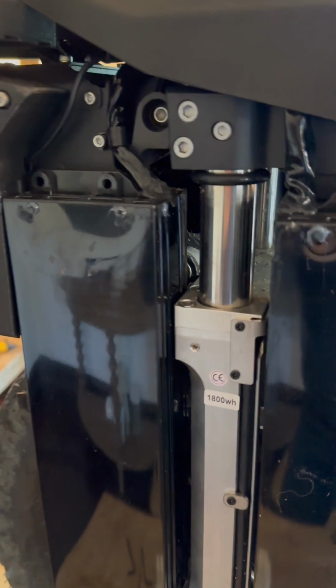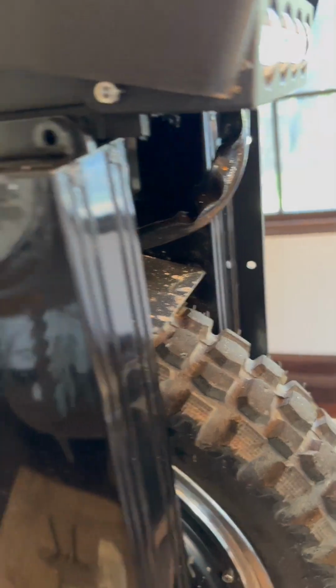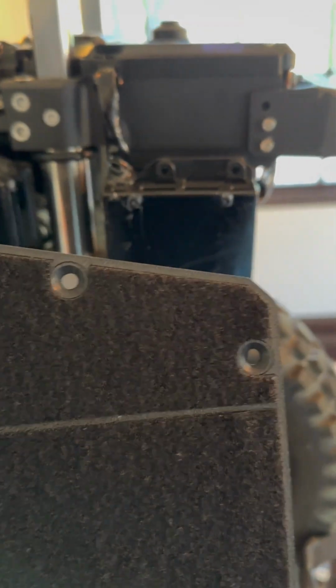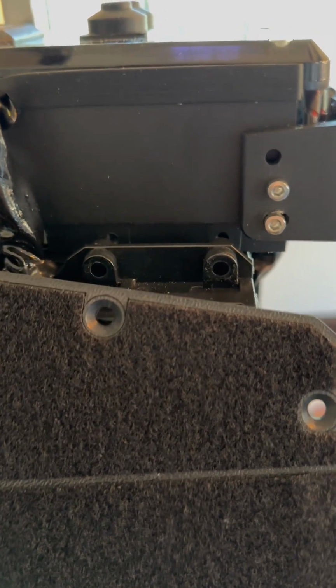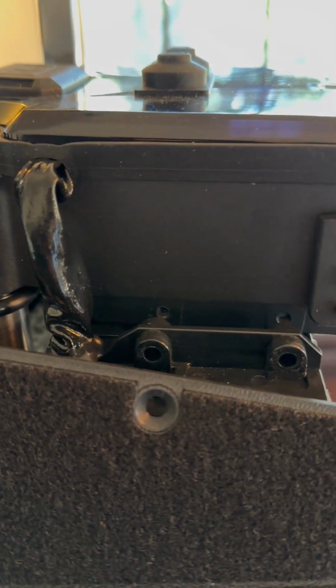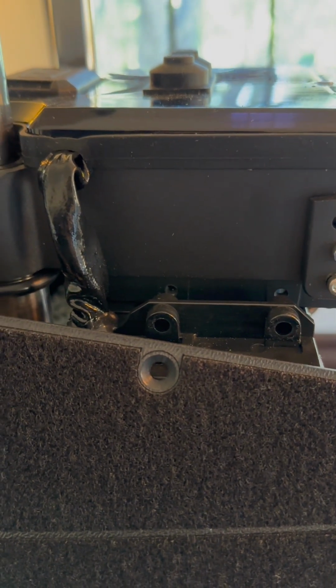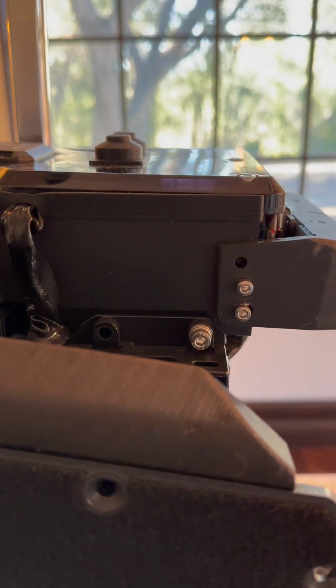Okay. I've got some silicone on these screws all around the inside, sides, outside. I'm going to put the other fairing on. One thing to be careful of is, notice that the top only has 3 screws up here versus 4 down here. So the one right of this screw hole, the one on the right there, needs to have the old screw left in. So don't forget to put that in and tighten it before you put this fairing on, like so.